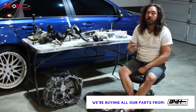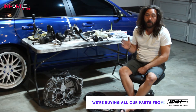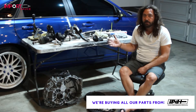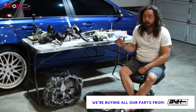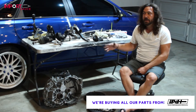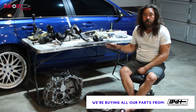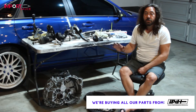The flywheel is the wild card. Volvo sells it for $1,100, but we are upgrading to the single mass flywheel from Viva Performance, which comes in at about $570 with tax and shipping — and it's about seven pounds lighter, so you get performance right off the bat. There will be a little chatter, which is why we're going with the S60R clutch. Clutch, flywheel, pressure plate — these are non-negotiable, always buy new.